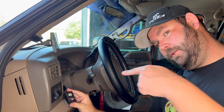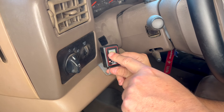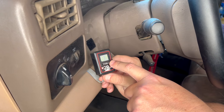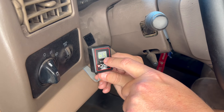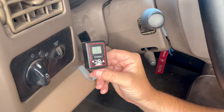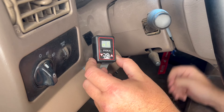Real easy to do — let's take a look at it. So right now we have our selector switch. We already went through going up and down on tunes, but if you go to the very last tune — this one has a lot of tunes because we use it for testing — you'll see an NS, or no start. This is no start. What it means is you put it in this tune and this truck will not start.